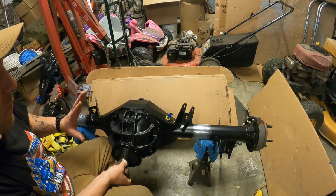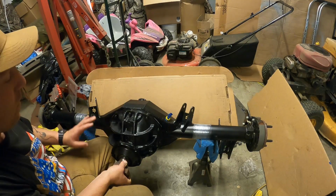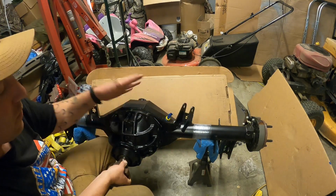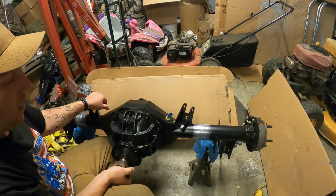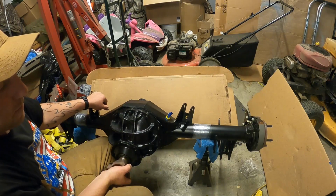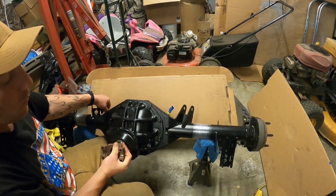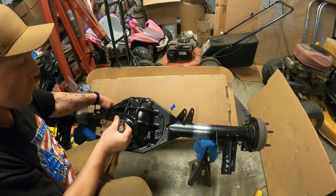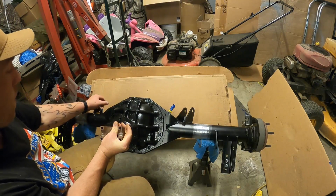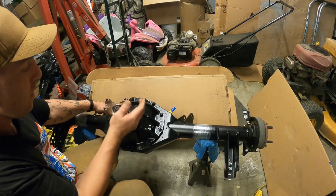Now, if you're looking at doing this possibly to your F-body, with that 4-link kit, they do send all the ears to weld onto your standard 8.5 inch rear end that came with your car, or 8.2. Other than that, I ordered this, a quick performance rear end.